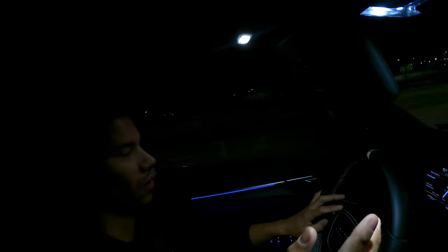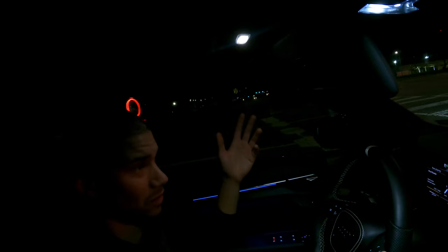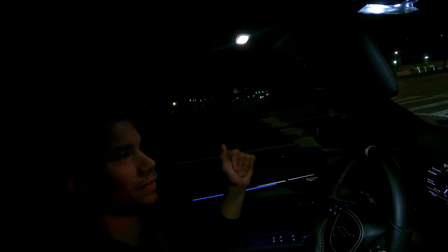Anyway, this thing is smooth as hell. This E85 file, I've been mostly beating on it more than anything. I've already used about a quarter tank of fuel. And, well, I really, really like it. We're going to have to see what it really feels like daily driving to and from work, here and there, everywhere. That's what really counts, how daily drivable the tune is. And that 93 tune is awesome, and I don't expect this to be any less smooth by any means. Just a little more power on tap, a little worse gas mileage, of course, because it's E85. It takes about 30% more fuel to power the car, really.